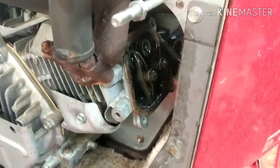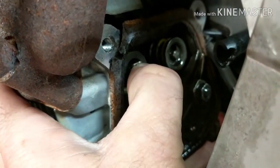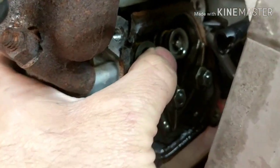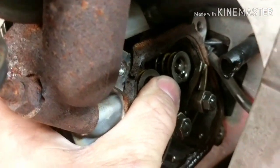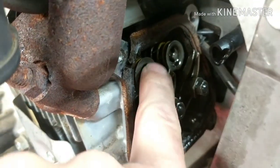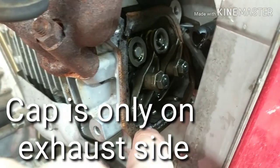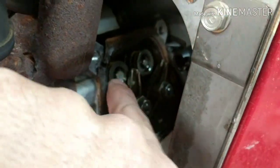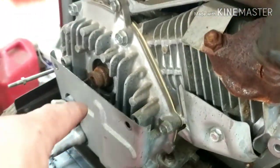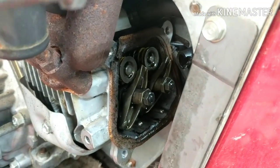With these engines it's really easy. You can push these springs down easily — just take it, push it, and move it over to the center, so now the valve is all the way up. These don't have the same retainers, they just have little caps on them, so when you put them back it's simple — just push it down and slide it back over. Now I have the engine at bottom dead center with the rockers off the valves, so I know the valves are completely closed.